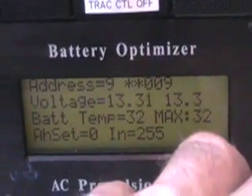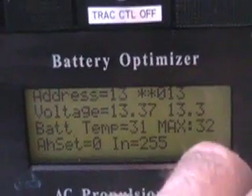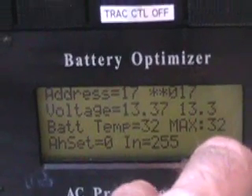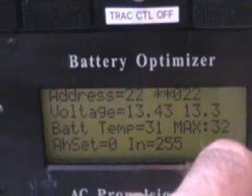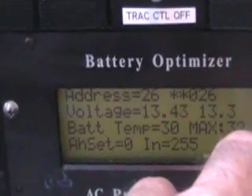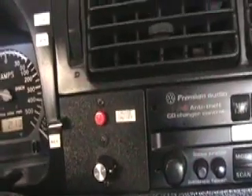This is a really wonderful thing that AC Propulsion has devised. On each battery module there's a battery optimization transmitter that allows you to look into each battery individually and see what it's doing. It can actually transfer voltage back and forth, and you can individually charge each battery from this control. There's also 100% adjustable regenerative braking, anti-skip traction control.